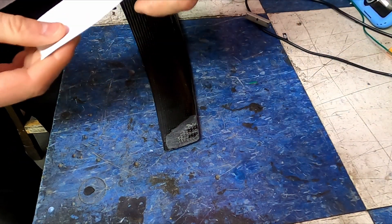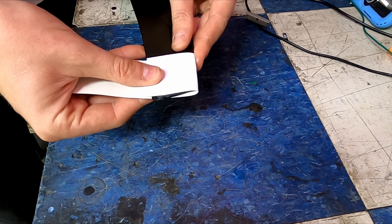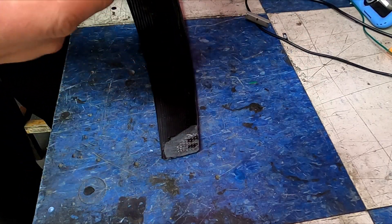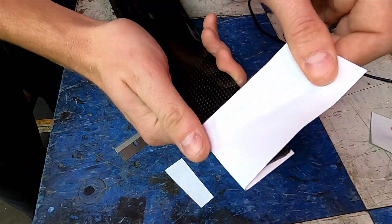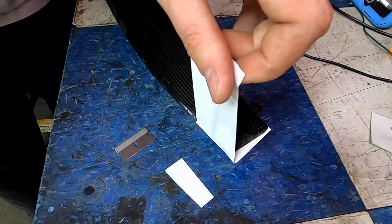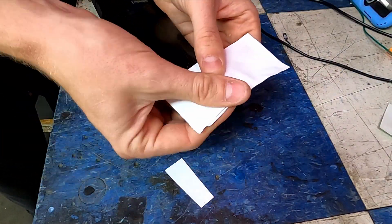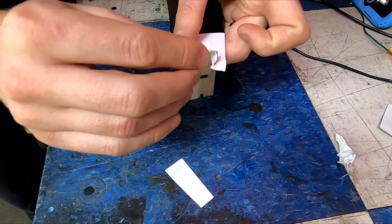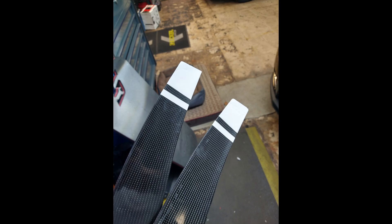Now the repair itself was fine, but it looked really bad. So this is me taking a white vinyl from my work and making tips — I think it turned out pretty good. You want to wrap it around the leading edge so that as the propeller spins, it's not trying to peel off the decal vinyl. Take a razor blade to the tip and to the trailing edge to trim off excess, and a heat gun to get the bubbles out. I also added a little stripe — I think it looks pretty sharp.